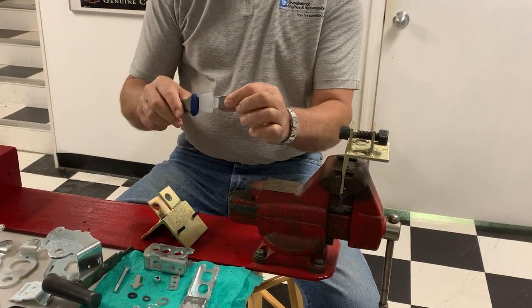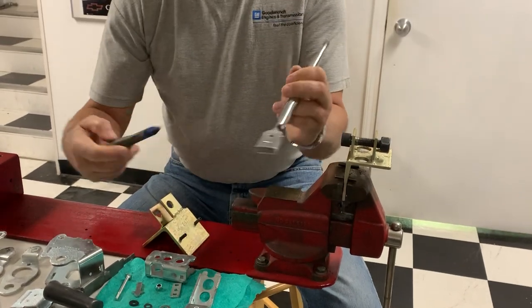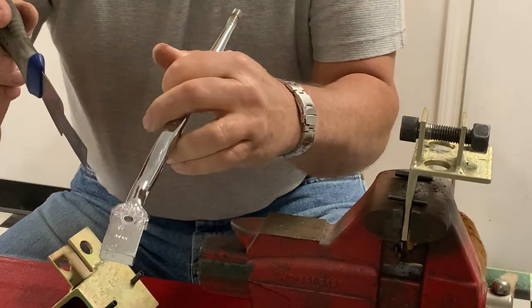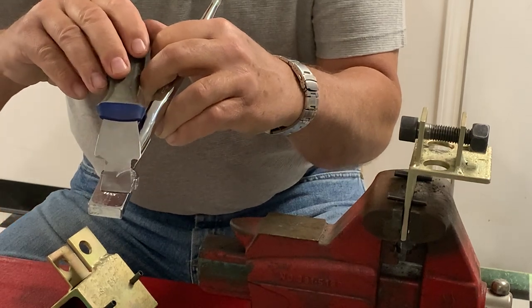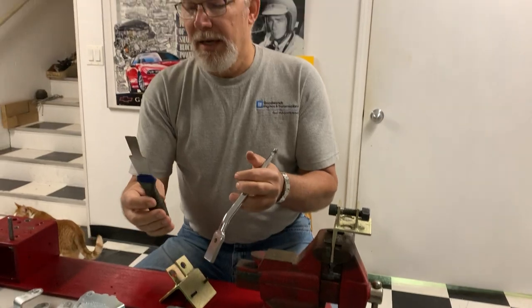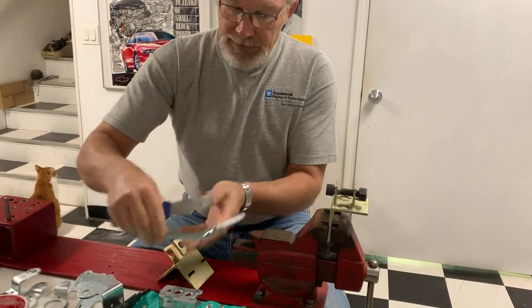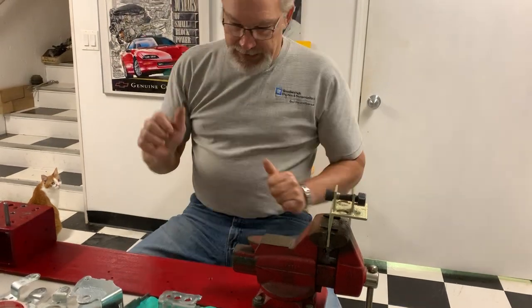The other tool I made — you get the cheapest, most flexible putty knife you can find. That's used for the tab on the shifter: the insulator has a little piece of stainless steel that springs into a tab, and it's always on the driver's side. You slide that in and it pushes the stainless steel tab away so you can pull the handle out. You've got to cut it down so it's the width of the handle itself. And there's the new handle back from chrome.